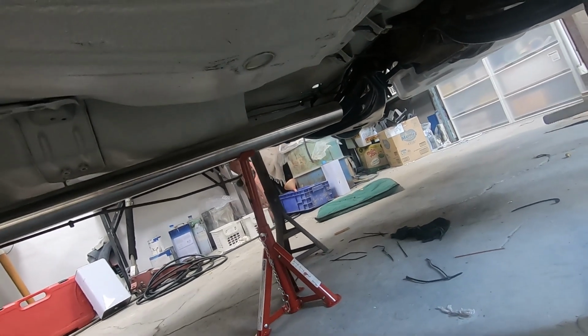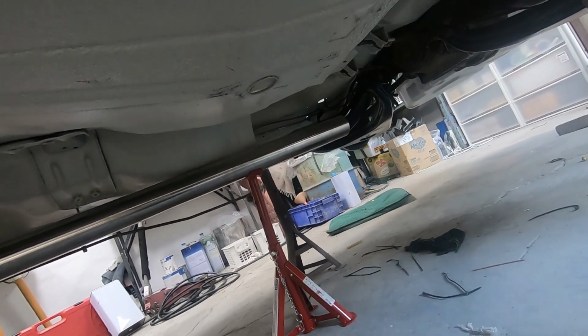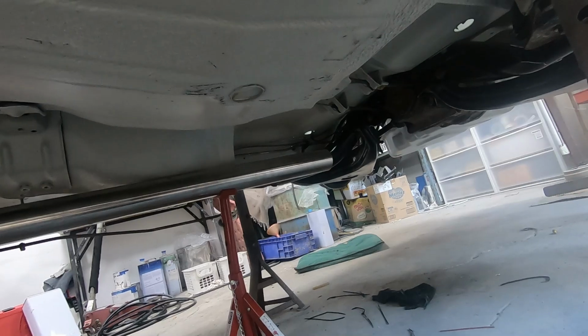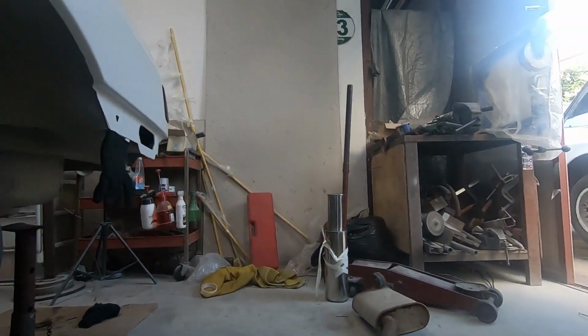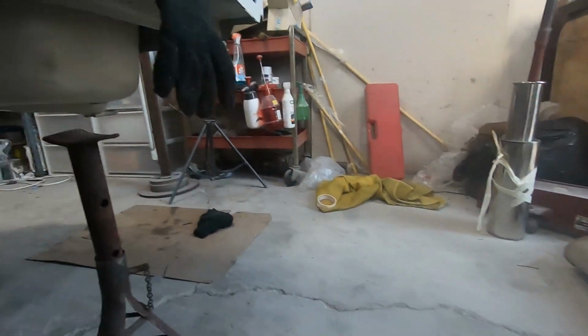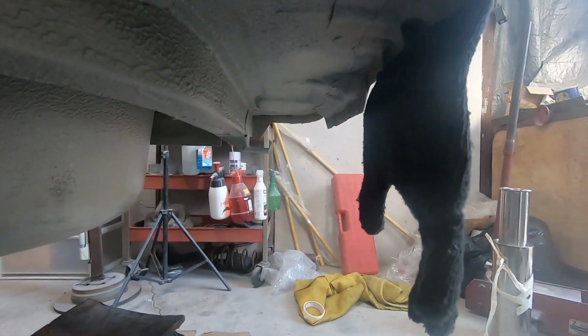What's the exhaust? Yeah, the intake. The exhaust was on the left hand side. The exhaust on this one is on the right hand side. For some reason it crossed over and went in there and came back again. It's good news. So basically that's got to run across there, and then it comes through between the diff and the trailing arm, and then comes out up here, and the silencer hangs there.